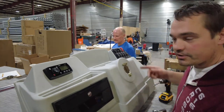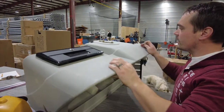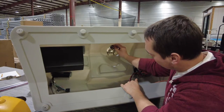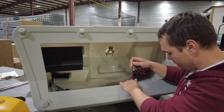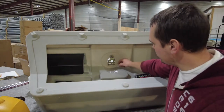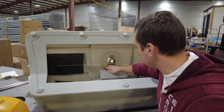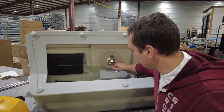Josh is here — we've got our bolts in and I just flipped the console upside down. This is what's nice about working on a table. You can see that bracket in there. I do have to put some spacers and washers in because these bolts have a collar on them. If I had some brand-new 5/16 stainless I'd use those with a nylock, but we're going to use what we have. We can flip this on its back side and work on it easily. The standard console is a little smaller and more of a challenge. I haven't found any need to put a plywood backing board on this console — it's pretty sturdy when you get everything together.